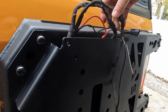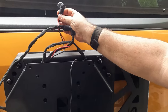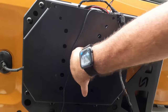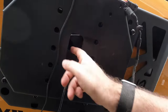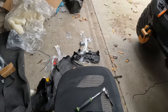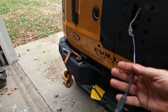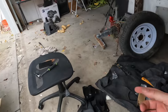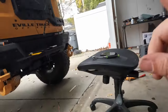This would be for the brake light — actually this is the power and the ground used for the license plate lights. The new camera is running through here. The instructions say to install the camera on there and run the extension, but since we had to do extra work with the extension I'm just running it through there. We'll skip to putting this part together, then run that wire through and connect the camera afterwards, since we're doing this a little backwards — we didn't have the nice easy quick connect that apparently other Broncos have.